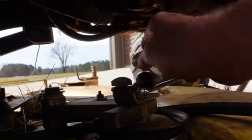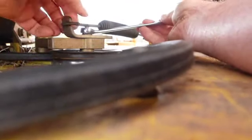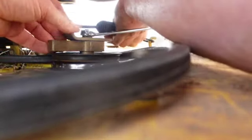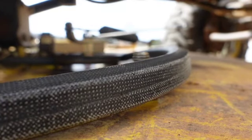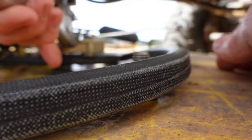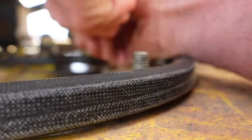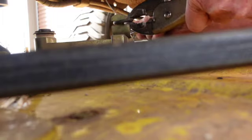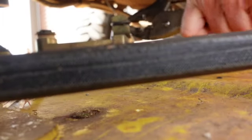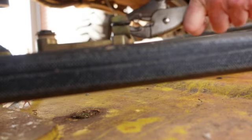I need both hands but that takes all the tension off. That belt's looking a little glazed. Fighting it with any pressure on it would be tough at best.